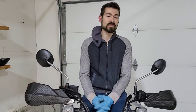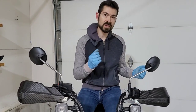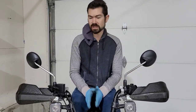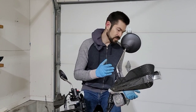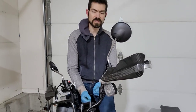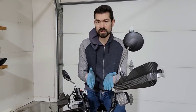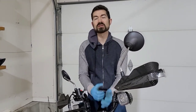So overall, I'm pleased with the experience. You will have trouble getting everything lined up and getting that rear axle in. That was a bit of a struggle. And in addition to that, please be safe. The center stand is really designed for the bike to be fully upright, both wheels in place, everything's good to go. We ran into a bit of a problem in that the front was too low and it wanted to generally rock off of its center stand. So using a front ramp, I think, was perfectly adequate for what we were trying to do. Basically, the reason that I wanted to drop the front at all is so that I could easily drop the wheel out so that I could get the chain off of the sprocket and out through the back.